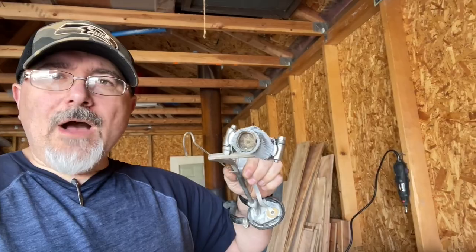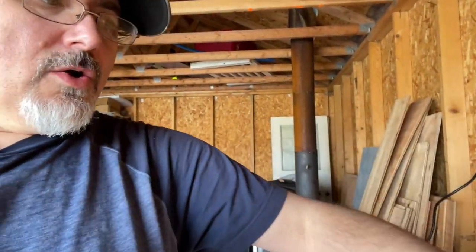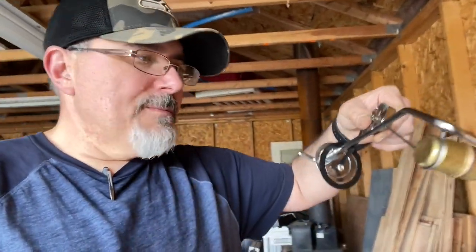I got the parts I needed. I pulled out the pickup tube and sending unit — it was cracked. I did find a replacement; this was actually a harder-to-find piece. I got it on e-Classics, I think it was called. A lot of the other parts I'm finding on Amazon, but not this one. I have a new one with the pickup tube and sending unit, so I'm going to put this into the tank, get it all sealed up, put the tank back in the van, and hopefully try to start it.